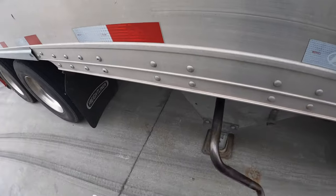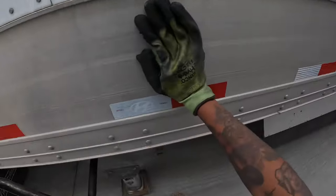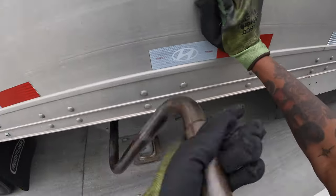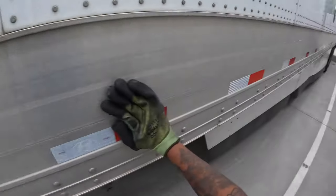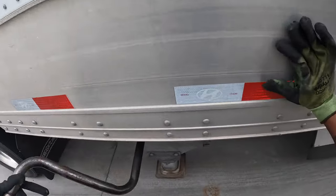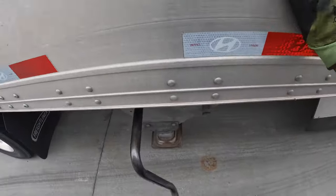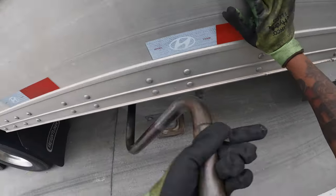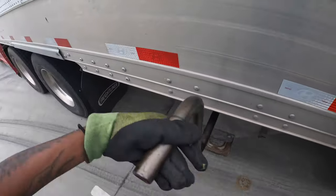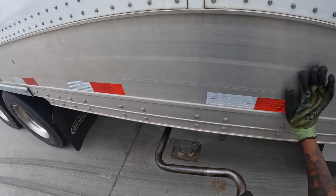Some loads — they're heavy but not too heavy, and the axles will already be done for you because they got to axle it out per California's bridge law. If you can't axle out the weight at bridge law minimum, basically the load will be illegal coming out of Cali. Other states you can chance it, but nobody's gonna chance it in California because Cali DOT is crazy — they don't play.